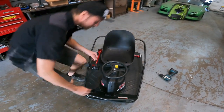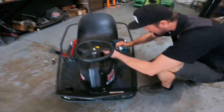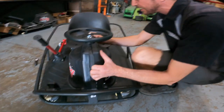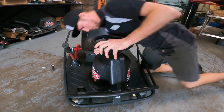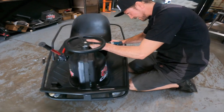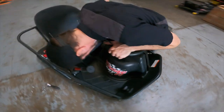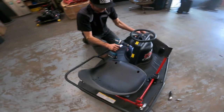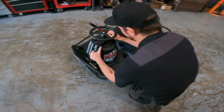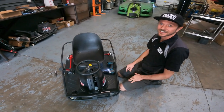So, I'm gonna take off this cover first. Just in case all the screws aren't unscrewed, I can go ahead and hit them a little more. Sometimes the XL covers are a little finicky and the nuts like to spin in the plastic. It might take a little coercion to get it out. Or it might be spinning. Yeah, in the other side of the cover. Exactly. What I didn't want. So, we're gonna have to take a quick break while I remove this unhappy nut.